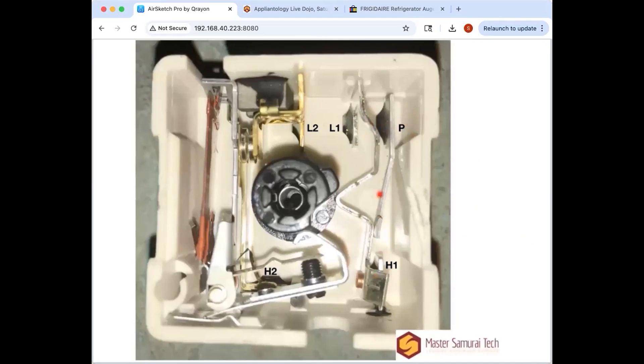As soon as you push in the knob to start turning it you're activating the L1 side of things. On this other side you have the contacts and the bimetal strip that can pull on the contact and open it up when the bimetal actuates. As current goes through here it heats up the bimetal and eventually it pops open. On the lowest setting you have basically no pressure from the cam on the bimetal, so it opens very quickly — that's how you get the lowest heat setting.